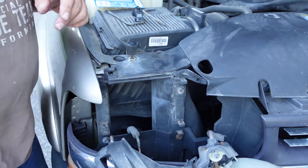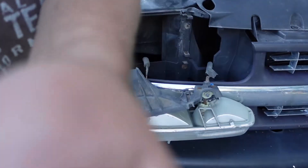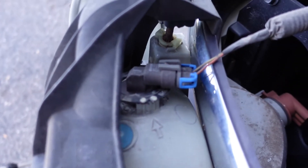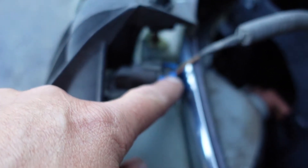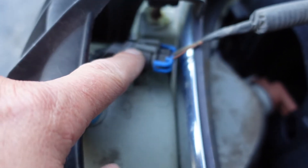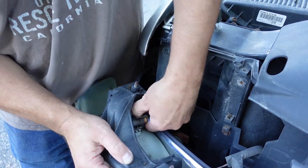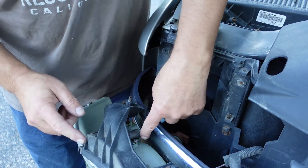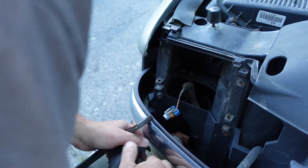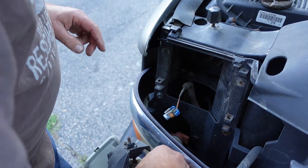Now I can get to the bulb. To pull this out — a little hard to see here — make sure I show it at least once on each side. This is the little tab you have to lift. You don't have to take this lock off; that's for the wires that are crimped. You've got to do this lock right here. I can't do it one-handed, so I'm just going to lift that and separate it real quick. Hopefully the camera catches this. And then this just goes counterclockwise to unlock — wait, this one actually comes out clockwise. My mistake.